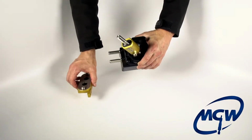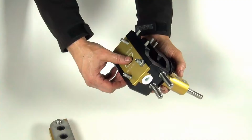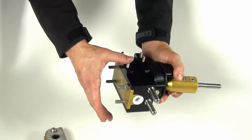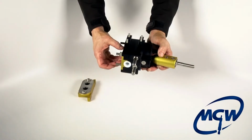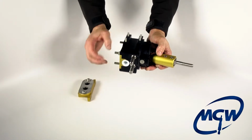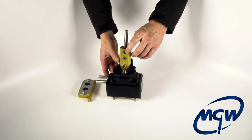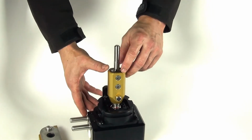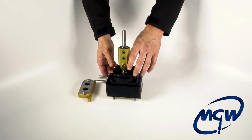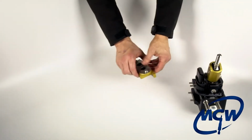for more firm shifts. The new design lower box, as you can see, it's got the removable lower plate so that you can actually mount the shifter to the car and service the bushings or disconnect it from the transmission without removing the shifter from the car. We have our new upper design that allows use of the factory OEM dust boot, which reduces costs, which we will be passing on to the customer this year as well. Put those to the side and we'll show you the kit.